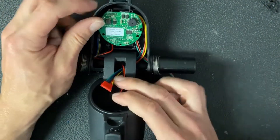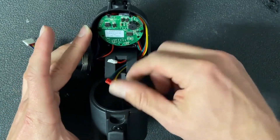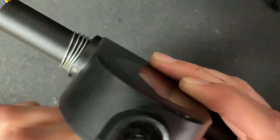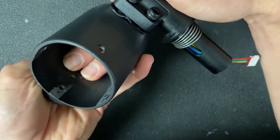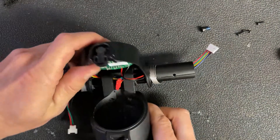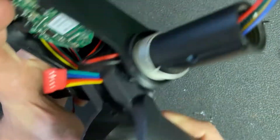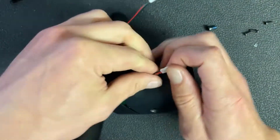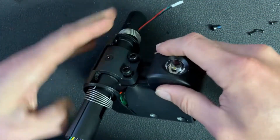To speed this along, there are three more screws on the bottom. The last step is to get the headlight line down through the bottom, which is pretty tricky — come in with a pair of needle-nose pliers and get it seated through the opening so it comes out on the other side. Once you've got it out, pull it through — it's going to attach to the headlight. If the headlight is fine, you can reattach the same one.